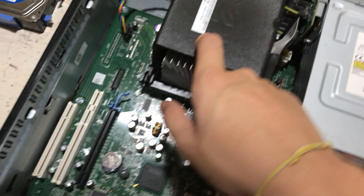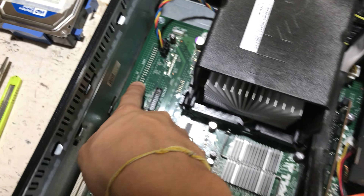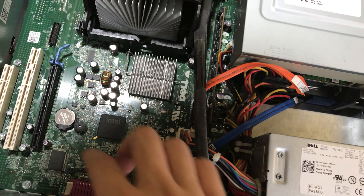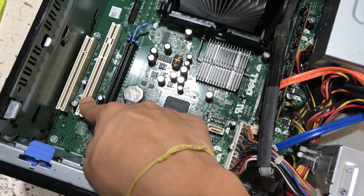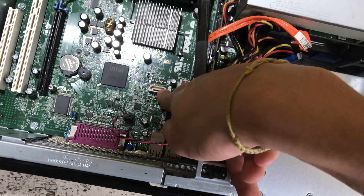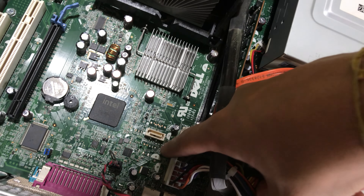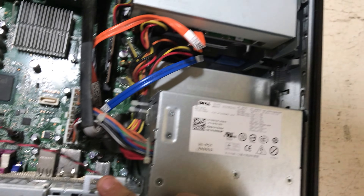The fan header for the CPU cooler fan is here and the heatsink is there. As you can see, this is a relatively lower-end Optiplex — there are many places on the board for additional soldered components that have not been populated. There's a speaker buzzer, CMOS battery, PCI Express, PCI, and an odd-looking PCI slot I'm not sure about. There's also another SATA port and what appears to be a fan header that could be soldered in.